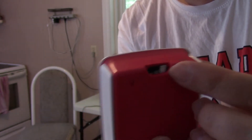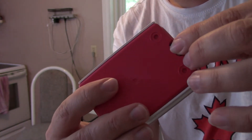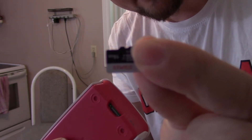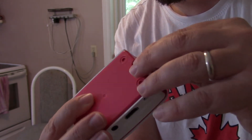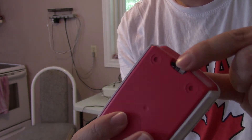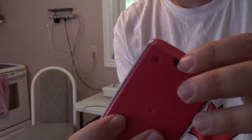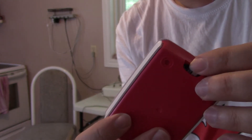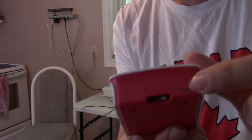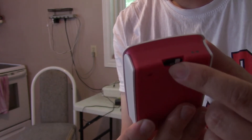The extra cost includes an SD card. The SD card just pops in like this — this is a 16 gigabyte micro SD card. You can choose the operating system; I'll show you later how to install the image you download off the internet. The operating system runs off this card, and it has to be formatted FAT32 — at least that's what I needed to get it working.